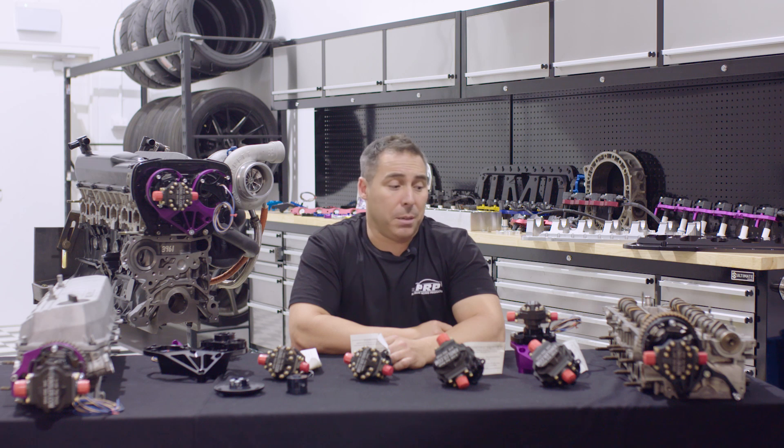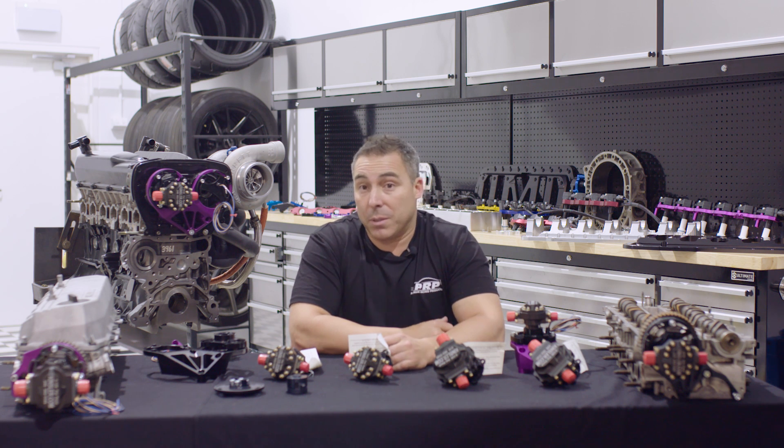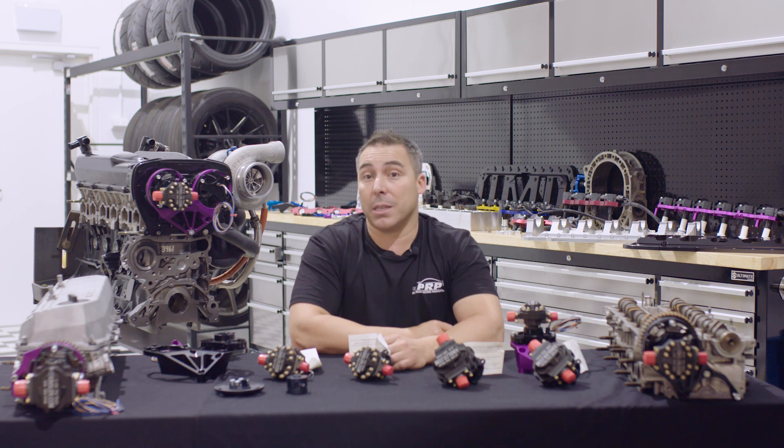People know how to tune them, and with a mechanical fuel pump, if you've got air in the system somewhere they can be hard to start — it needs to prime. But the way you should set it up, with a lift pump in the back of the car pressurising a surge tank, you've got fuel at the pump anyway. If it's sucking air from somewhere, it's probably a leak and you'll find out about it pretty quickly. We've done a few setups now, and much to my surprise, not even a couple of cranks of the engine and it's running. So it's no worse than before, and I think we've effectively debunked that myth.